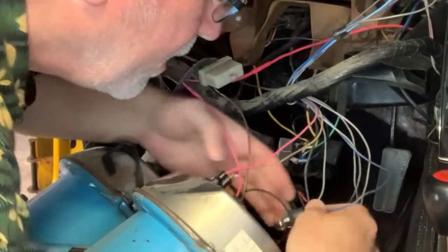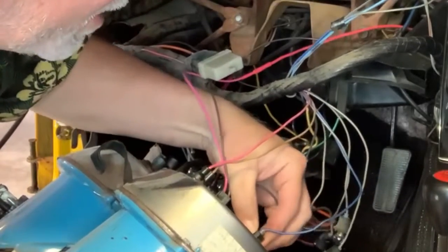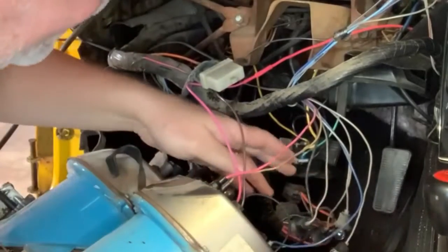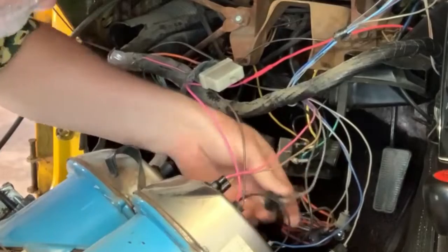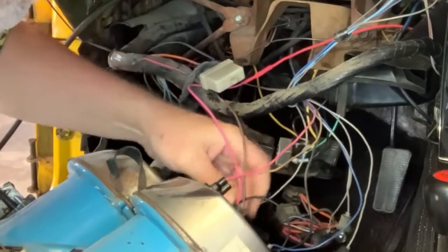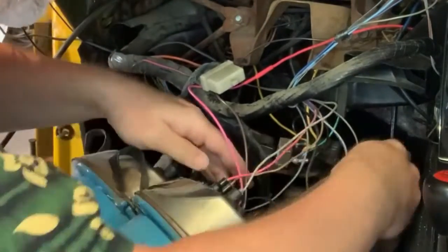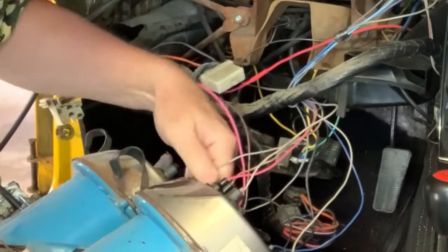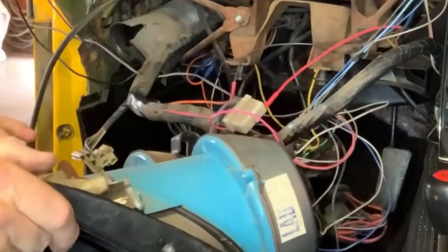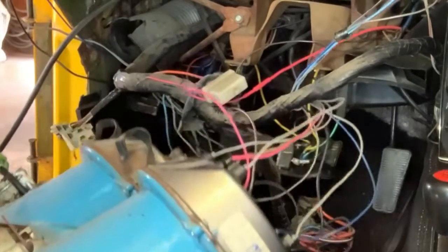Let's make sure that says dark blue back there. Gosh, it's hard to see. Yep, dark blue. That's the right turn indicator bulb. And all the rest that are left are gray, so they're just general instrument illumination. So there's 1, 2, 3, and 4. Okay. So that takes care of the tachometer side as far as bulbs go.